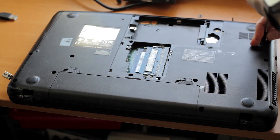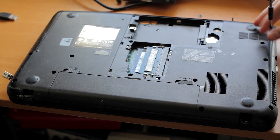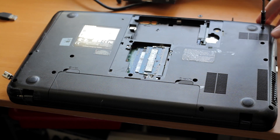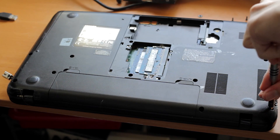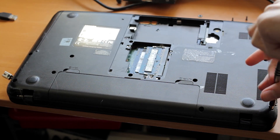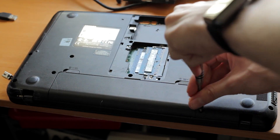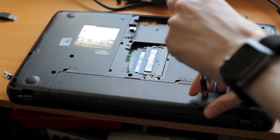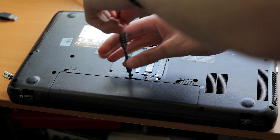Those are the simple upgrades, but we're going to try to do more. First of all is cooling — I don't know if there are thermal pads, but some laptops do have them, and you can get quite sizable upgrades by upgrading the cooling. And if we're going to take it all apart and do crazy upgrades, you can just shove your own fan on there and take some of these vents off, because having all these little vents and fins, while probably useful in a laptop, won't really help if it's going to just be sitting on a desk all day.